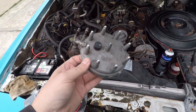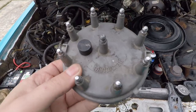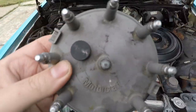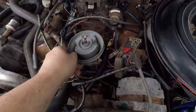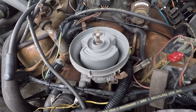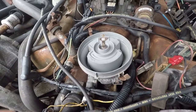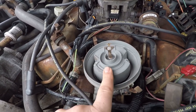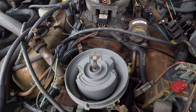All right. So I took the distributor cap off, which may have ended up being a mistake, but you know, that's okay. So that one is where the number one spark plug should go, and that should be pointing up. Ooh, this thing won't turn any more than that. Because it should be pointing, I think, back, the back of the engine, and it's a little off right now. So I still don't have fuel, but that may be kind of why it's not starting, really.